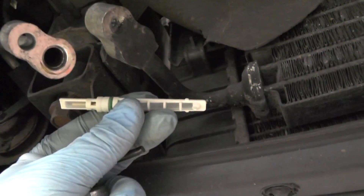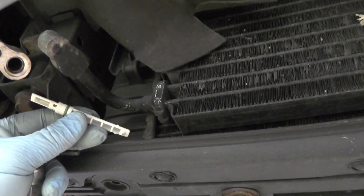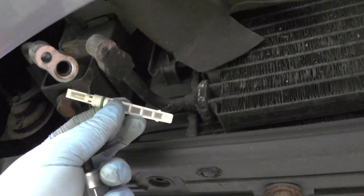I have the tube right here, and as you know, refrigerant flows out of the condenser and comes along here, and then it goes out this way. So when you go to put an orifice tube in, you want to make sure it goes in the correct direction.